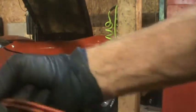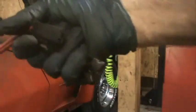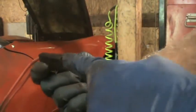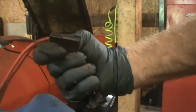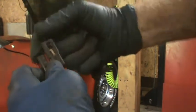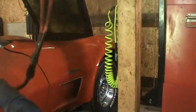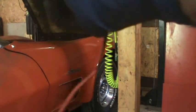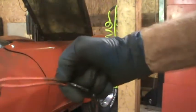Yes, actually I understand how it works now. It got fed in on one of the two wires. Okay, current got fed in. Let's just say for argument's sake, that it was fed in on this wire. I'm sorry, on this plug that goes to this wire. Well, then it would come right back up this other wire and go out to the other wire that was plugged into this, as well as continue on down this wire to the wiring harness for the original air conditioning wiring harness. So here's the way those two wires were connected.